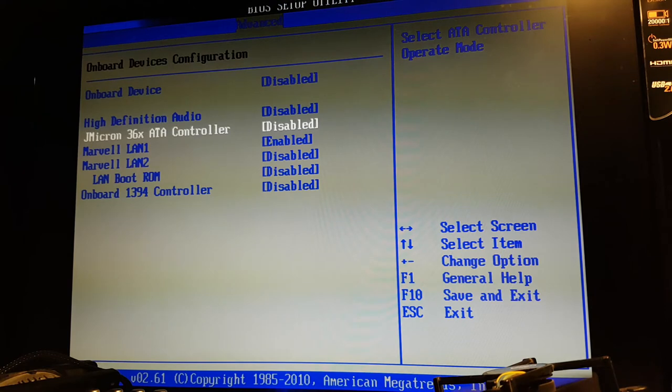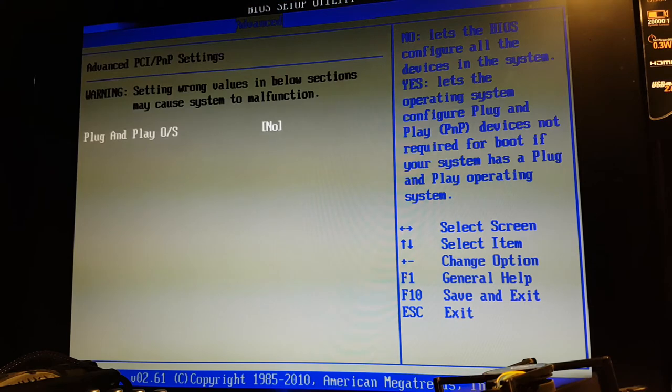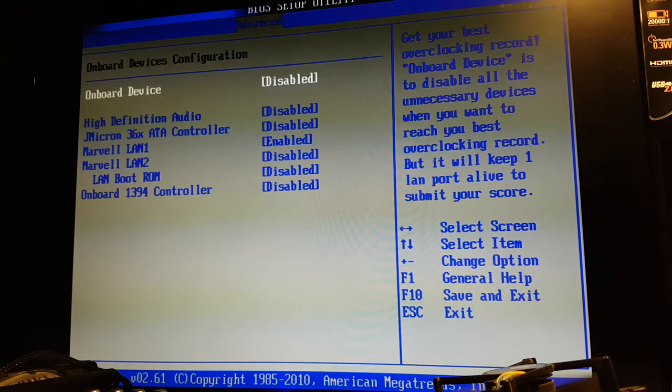I used everything I remembered and my experience told me. However, I couldn't make it work. I don't know why. Is it IRQ or something like that? I simply cannot make it work because PCI PnP looks like this. I can do yes, no, and that's that. So no IDE hard drives on Windows 7 and the last operating system. However, I can live with that since I have Windows XP that supports both IDE and AHCI drives.